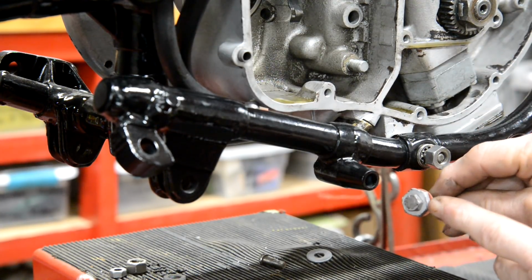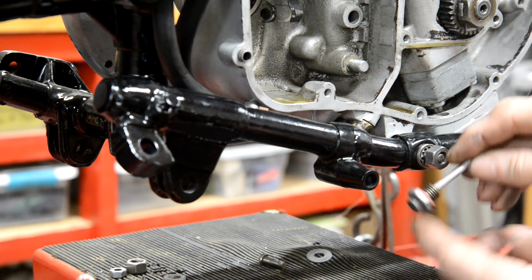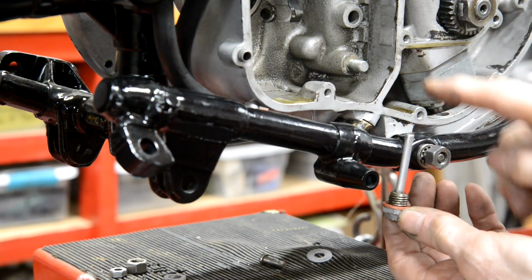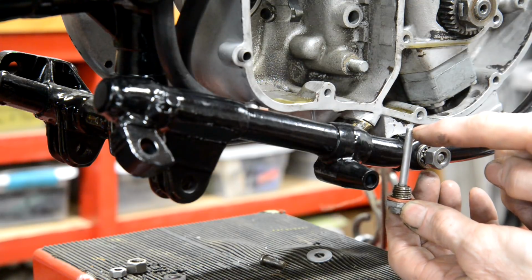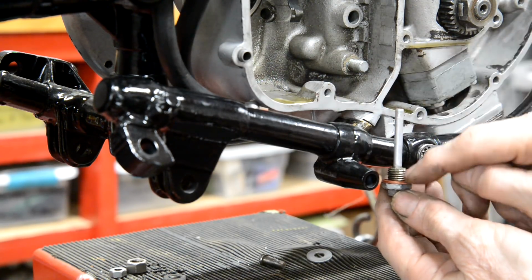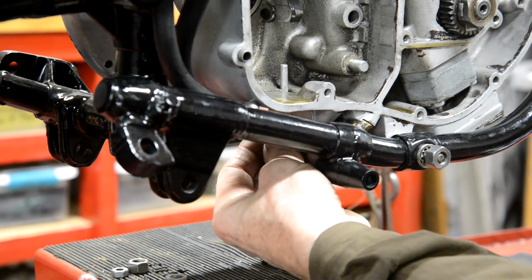Now the next thing we're going to put on is the gearbox drain. You'll notice it's got two hexes. This small one on the outside here opens up this, so when that's in there, if you take the small one out, any excess oil just goes out till it gets to that level. So it's a leveling plug actually, and then there's the main one. So that goes in near the back there.